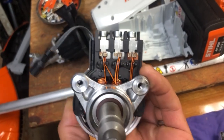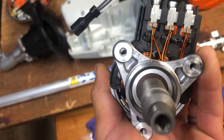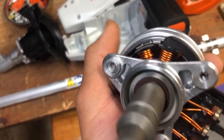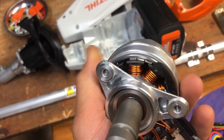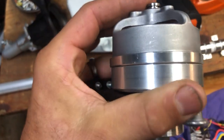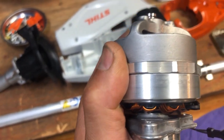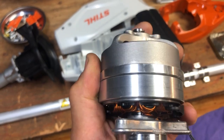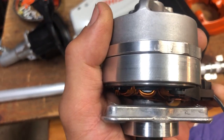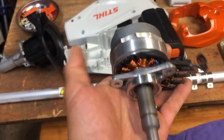The magnet wire is substantial. I couldn't find a caliper out here to measure it, but I'd eyeball it as being more than a millimeter in diameter, and paired. You can see the magnets on the external rotor, grouped in threes. The maker's mark — probably won't show up in the video — but it seems to be made by Dommel. I'm sure it's made specifically for Stihl, or it's an OEM version, but it looks like a Dommel 4888 is the first number I can make out. If I can read more of them, I will put them in the comments.